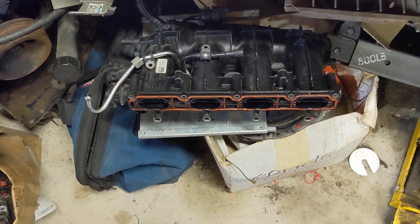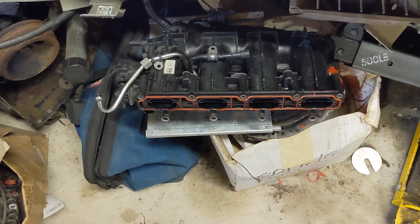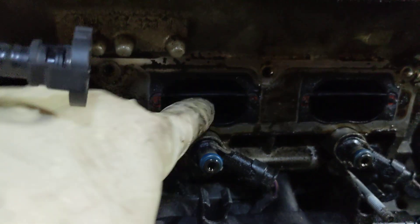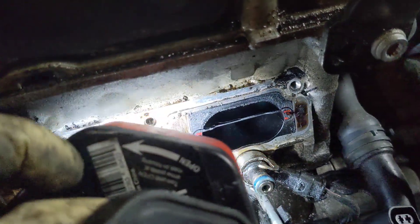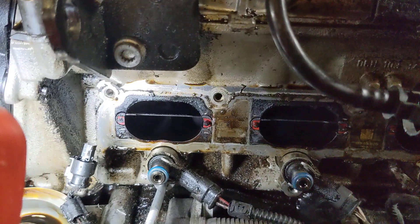I got the records of this car from the dealer. This was replaced under warranty in 2012, so I'm hoping it was like an updated version that was nicer. Another big problem they have is carbon buildup in the intake. I'm not really seeing that on this one — it looks pretty clean in there, the flaps move good. I don't really see a lot of carbon in here either. It looks dark in there, but I don't see anything that's actually caked on. So I'm pretty happy with what this intake looks like.